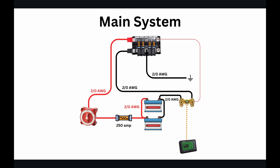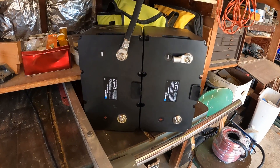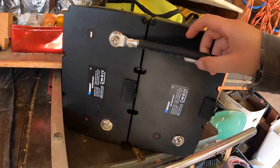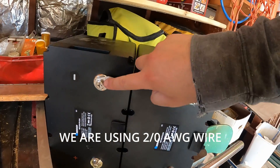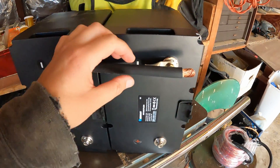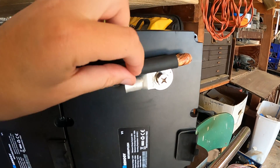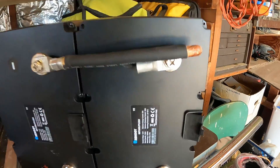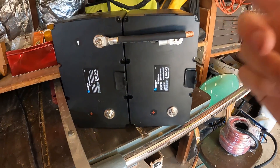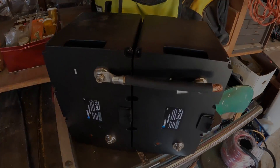This will include our lithium batteries and our Lynx Power-In, which is essentially two bus bars with spaces to add fuses. We're connecting our batteries in parallel. Right now I'm just making our wire — I already cut and crimped one side. These are 5/16 lugs to our Renogy battery. The wire is a little too long so I need to mark and cut it back, strip it, then make the crimp. For the positive side we're going to use a red wire and make sure it's exactly the same length so our batteries charge and discharge evenly.